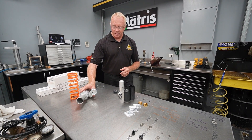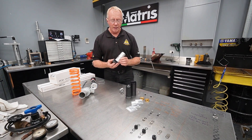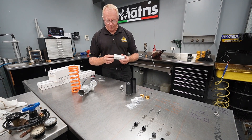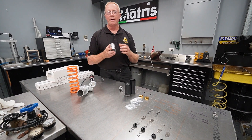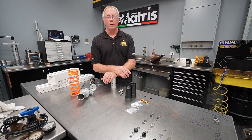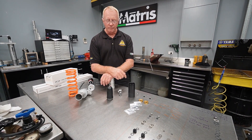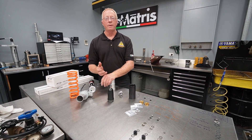It's not truly progressive — it's more like a two-stage damping arrangement and doesn't quite give us the progressive control that we want, so because of that it puts extra reliance on the spring itself. In this particular case we're also going to upgrade the reservoir and change it for a bladder reservoir. With the current sliding piston, it's not well aligned — it can cock, it can bind, it can create drag — and anything that inhibits shock shaft movement will inhibit wheel movement. When we put a bladder in there, it's simply a compressible medium that just squashes and returns to its shape, so there's virtually zero friction and we'll get much better wheel response.